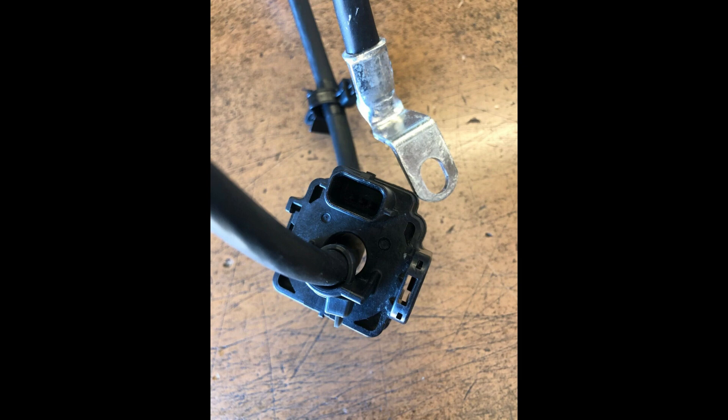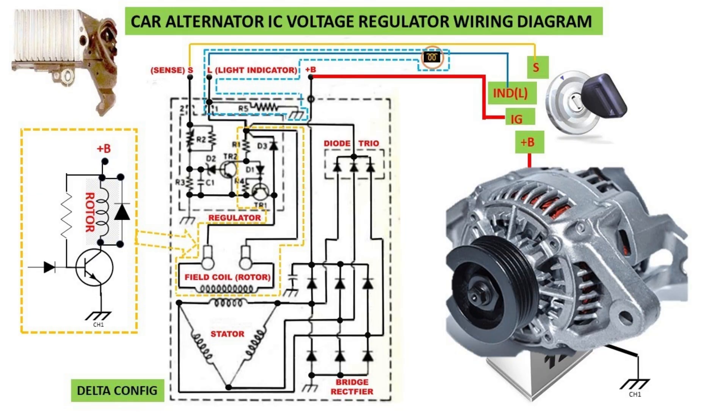So what did you gain? Before, watching my OBD2 Edge CS digital multi-gauge, the battery was usually running below 13 volts, which is not great. Most vehicles when charging correctly run between 13.7 and as high as 14.1 or 14.2 volts. After I disconnected it, I've seen nothing less than 13.7. That keeps the battery much better charged — it cranks faster, the engine starts easier, and you've got a higher voltage being supplied to everything including the ignition control module.